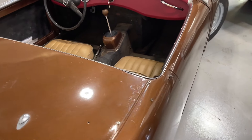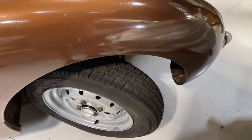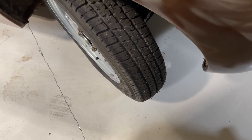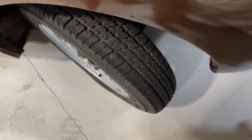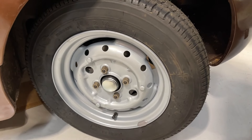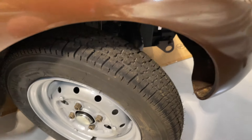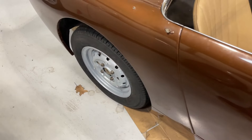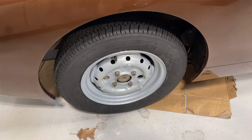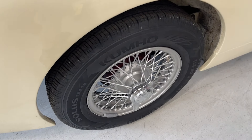This is a client's car that came to us from Georgia — he's working on a color change, and it has a restored dashboard. The car came to us with these tires: a 145/13, meant to approximate that 520 bias ply we just looked at. The problem with this tire is it's really too narrow. Driving it, you notice the car is very slippery — it locks the wheel when you really get heavy on the brakes because there's not much contact patch. This is the one tire in the video I'd honestly say is not useful.